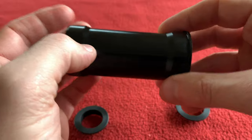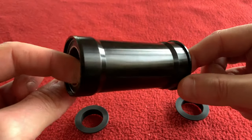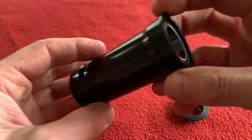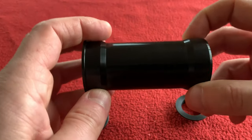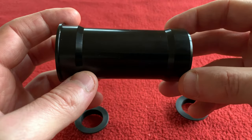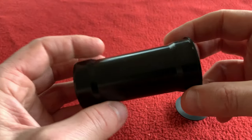This is £170 because it's a heat-treated alloy, so it's 20% stiffer. I'm very hopeful that I will not have any creaks with this press-fit bottom bracket. As I said, it's got aerospace tolerances — it's guaranteed not to slop around and it's guaranteed to fit exactly in the hole, providing the manufacturer of the bike has left the right size, shape, and dimensional hole in your frame.